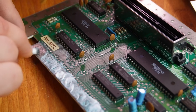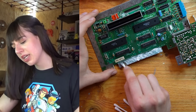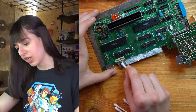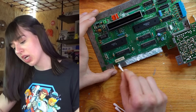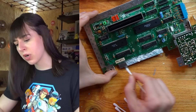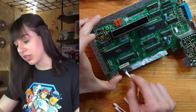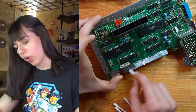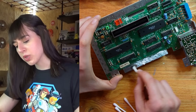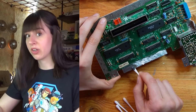I'll clean it off with some isopropyl alcohol and honestly it already looks much cleaner — it should make much better contact now. I was worried those corrosion marks wouldn't come off, but obviously it couldn't read cartridges in this state. I need to remove all the polish and then, once the q-tip comes out completely clean, I can move on to the connector pins.